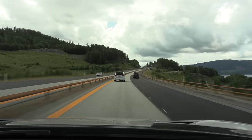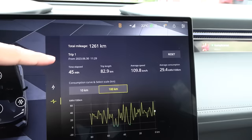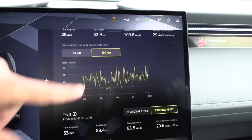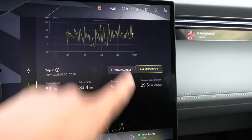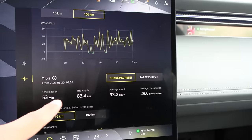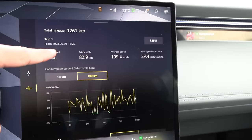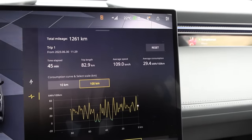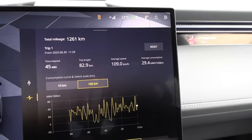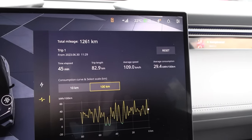We got stuck behind slow traffic. We are back at Ionity now, so I will note down this first segment from the airport. The trip meter is a little bit clumsy — this one seems to auto-reset for charging. I'll use this one based on 93% we started with to estimate net capacity. Let me reset and then try the 120 km/h consumption test.